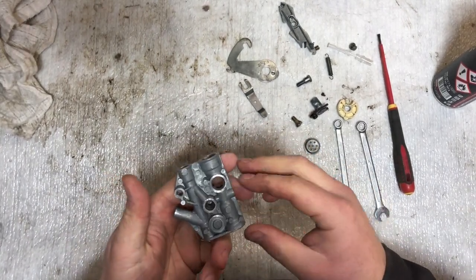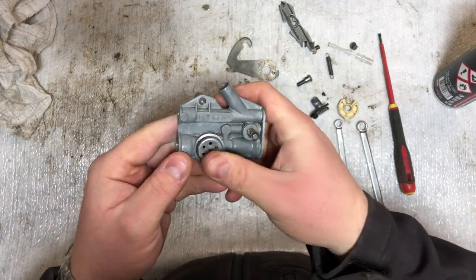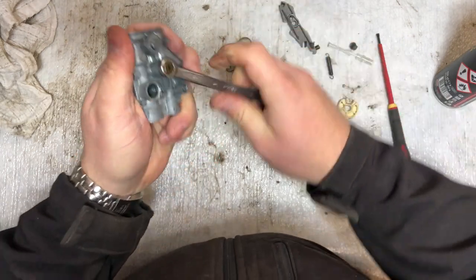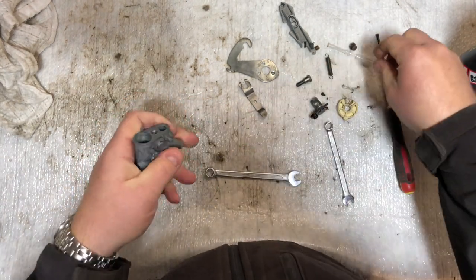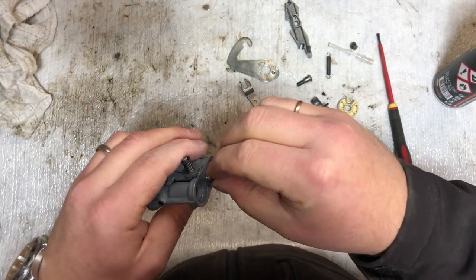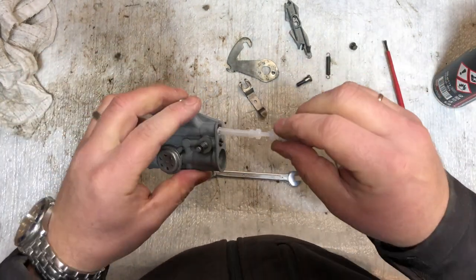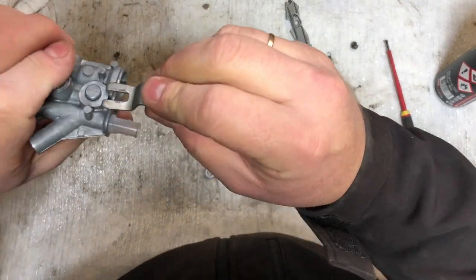It's fairly simple to put it back. We can put this piece in as the first one here, then tighten this — but don't tie it too much. The cap is made of not-too-hard material so you might over-tighten it and actually break it, so be careful with that. Put the gasoline filter back in and you can put the arm back on.